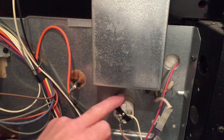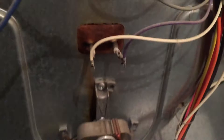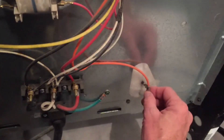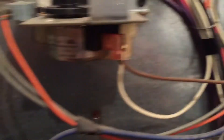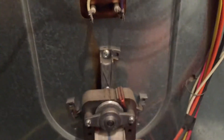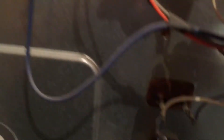That's your light bulb socket for in the oven in there. The rest of our stuff - we're going to check any loose wires. This is on one side of your bottom heating element, here's the one on the other side, and your top heating element - we've got one up here and another one over here. So those are both tight, nothing's wiggling loose.